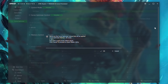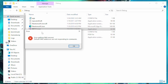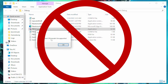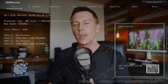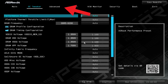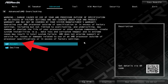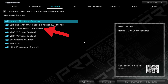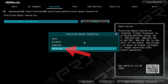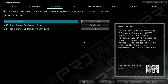The system reset just in time for me to hit Delete or F2 and go into the BIOS to manually change settings. Unlike yesterday's tutorial with the 5700X3D, the PBO2 Tuner program didn't work on the 7800X3D, so this is the quickest and best method. Go into AMD overclocking settings from the advanced tab, accept, go to curve optimizer settings, change to manual, go into the advanced setting, change it to negative, and lock in the previous stable value — in this case, minus 30.